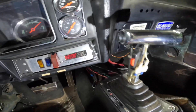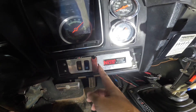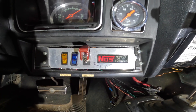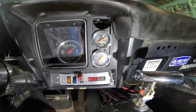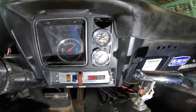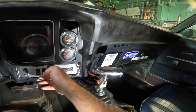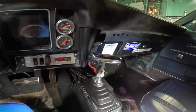This is the electrical system of the nitrous. You've got 12 volts going to this arming switch. If you keep it unarmed you can go wide open throttle and the solenoids won't activate. Once you arm it, the micro switch is hot, and once you go wide open the micro switch activates the solenoids. After the pass I shut it off. I also have it hooked up to the purge — this is my purge button — so when it's armed, the purge is also active.